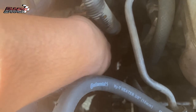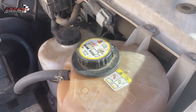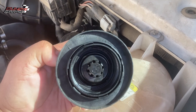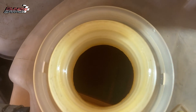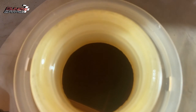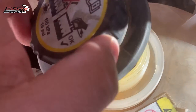So if you don't have very much time to look at a vehicle and you see these symptoms, or you think you have a blown head gasket, walk away unless you want to do a head job. Also, another thing you're going to notice is that the coolant in the reservoir bottle — or if you have access to the actual radiator cap — it gets low over time. Right there I'm trying to show you that the reservoir coolant bottle is low on coolant.